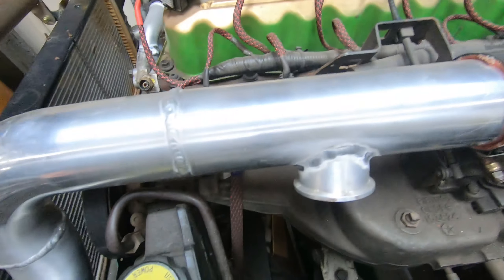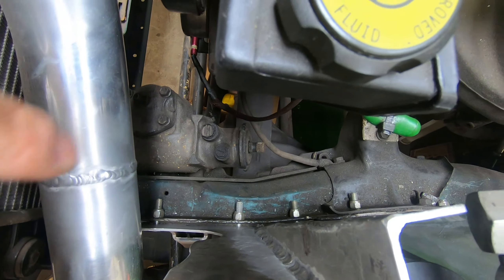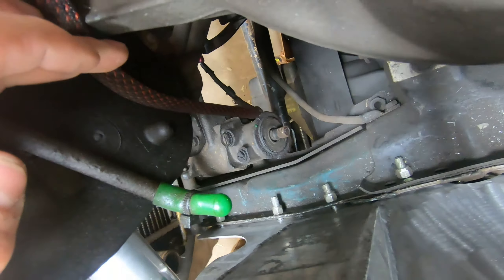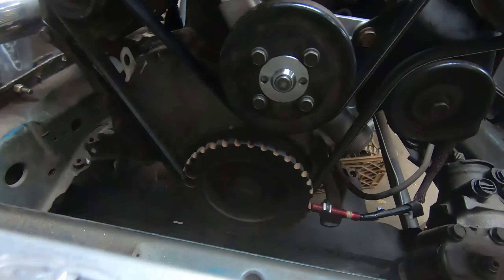This power steering line is destroyed. I have a newer power steering box down there and we've got to redo the lines. When I was taking off the return line on the reservoir, this guy cracked right off — so I'm assuming this is probably the original reservoir and pump. The pump has been working fine and doesn't burn fluid, so we're going to attempt the dreaded reservoir change. You've got to take it off and there are these metal clips that hold it on — I've done it before on customers' Jeeps, but it's a little bit of a pain.